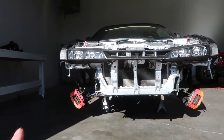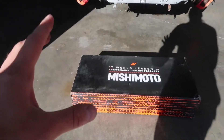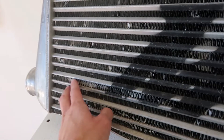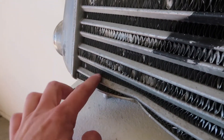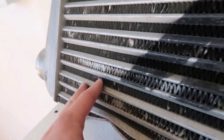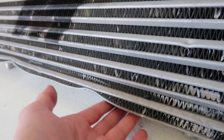We're able to use our old piping and everything and just replace this core. Here's our old intercooler core — this is called tube and fin. If you look at it, how it dips down between the fins or the tubes and then back down and up — it's really weird, I've never seen that before. I just assumed it was a cheaper intercooler, and it is. Tube and fin design intercoolers are susceptible to damage when used in front mount intercooler situations, so we're getting rid of this one and replacing it.